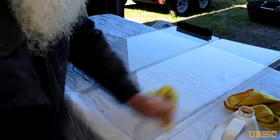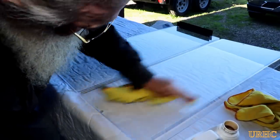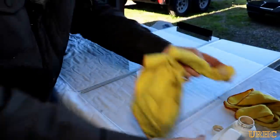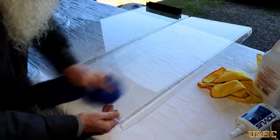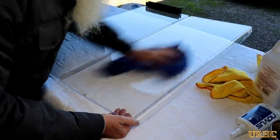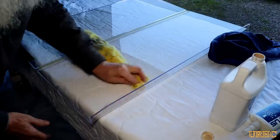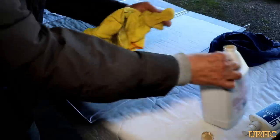When you were facing into the sun you just couldn't see out of it - it just reflected and glared. I'm starting with the number two polish which is basically like a fine rubbing compound. You put some on, rub it in good, and just keep buffing it until it turns into a powdery substance, then polish it off with a clean rag. It does take a little elbow grease and won't take out the deeper scratches, but it works pretty good. Some areas I had to go over twice and each time it got a little better.